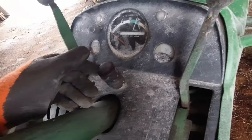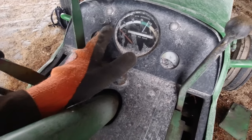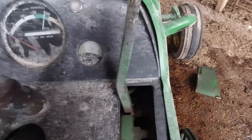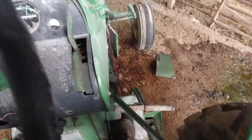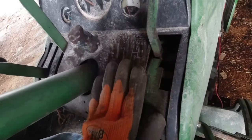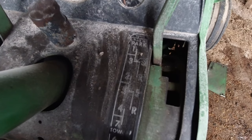This right here is just a little dome light to shine on here — it doesn't work anymore. We have installed an aftermarket temperature gauge because the other one quit. And the fuel gauge — ours doesn't work either. I think we have a wiring issue under the dash, because sometimes it won't get a solid connection and you've got to bang on it a little bit. Then we have our shifter lever — if I brush this off you can see the gear pattern. We have eight gears forward and two reverse.